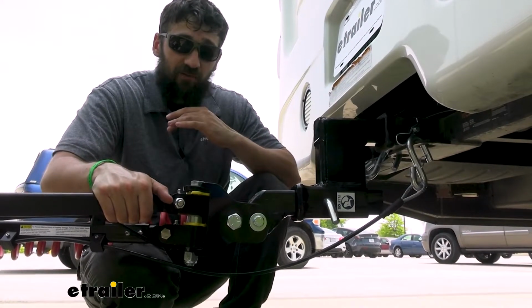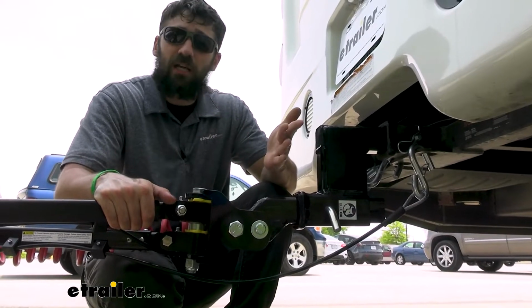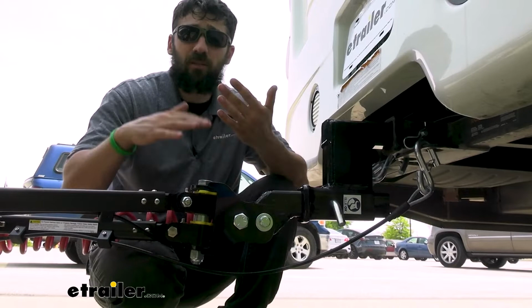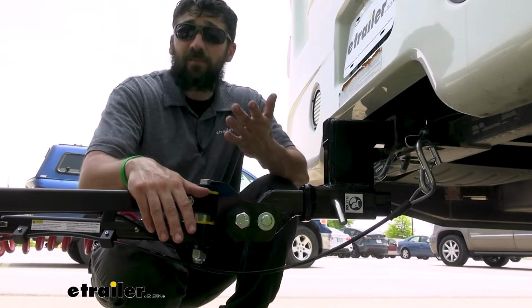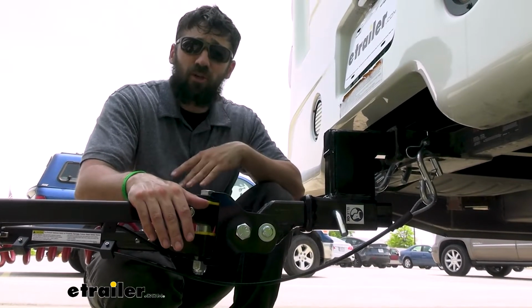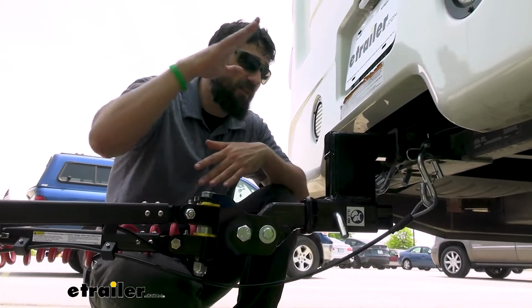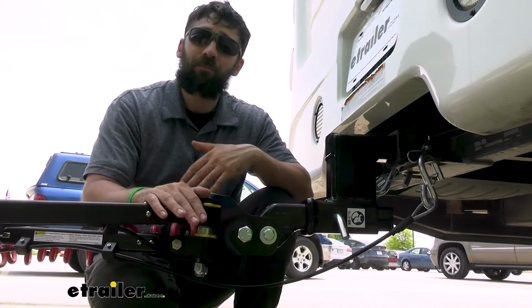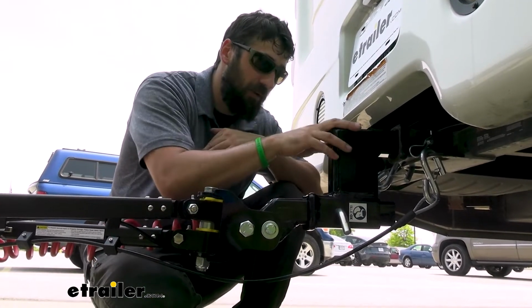And I would say for the vast majority of towbars, it's pretty uncommon for the vehicle and the motorhome to be within that range without requiring some additional assistance. Sometimes that is happening, but a lot of people like to flat tow Jeeps. They sit really tall, or they have a larger motorhome that sits really low. So there's always going to be a gap between the two, and that's where a high-low adapter comes into play.